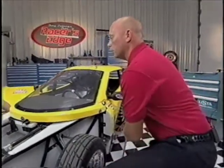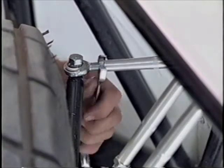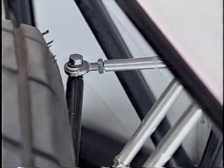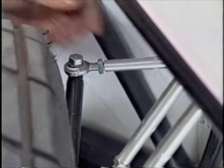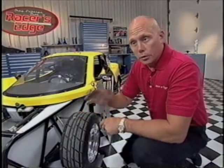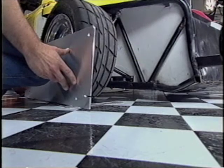Let's go ahead and take that loose on that side and we'll get a good adjustment going. Part of the thing with toe on these vehicles: if you want a vehicle to go down the straightaway really well, you want a little bit of toe out. If the tires are toed in you're going to get that vehicle wandering, so a little toe out is always good — it keeps the tire loaded, keeps the car pointed in the right direction, and gives you that feel in the steering wheel you need.